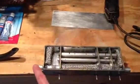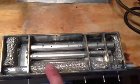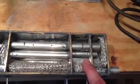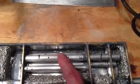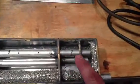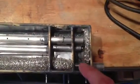The exhaust enters in through this pipe, passes this resonance chamber, continues on into this noise cancellation section with a couple of holes going through the aluminum mesh, into this chamber where the majority of the exhaust enters, into this resonance section, back through the small tubes with noise-canceling holes, into this resonance section with more mesh, back this way with the larger tube with some noise-canceling holes. There are no holes in this tube here, passing this resonance section, back into the final resonance section with more filtered aluminum mesh and out the exhaust port right here with more noise-canceling holes.